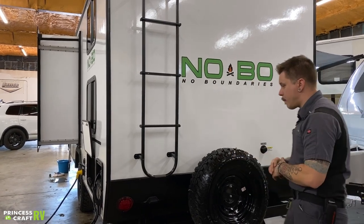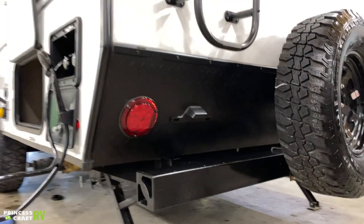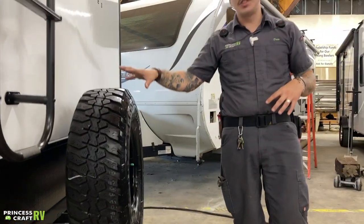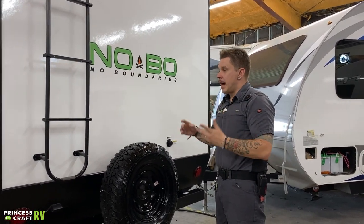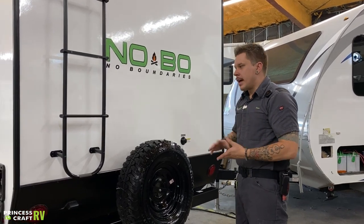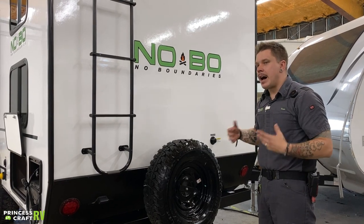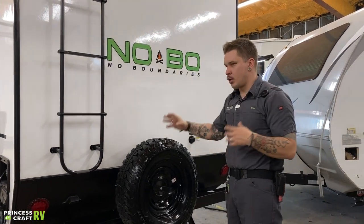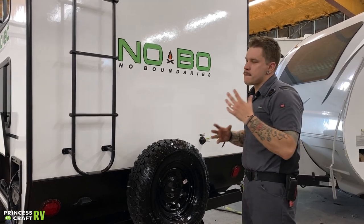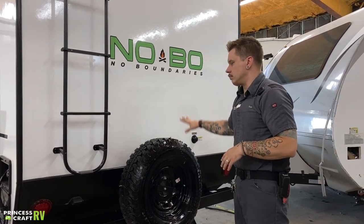Also here on the rear, we have your tube storage bumper. That's going to accommodate sewage hoses and things like that — any long storage items can be stored within the bumper. It does have a cap on each side that is removable. We also have a full-size spare tire here. When it comes to changing a tire on the unit, the unit does not come with its own jack and it does not come with its own lug wrench. So make sure that the jack and lug wrench that accompanies your tow vehicle is also going to accommodate you in changing a tire with the unit. Placement of the jack is going to be on the axle as close to the tire as you can get it without it interfering in your work.